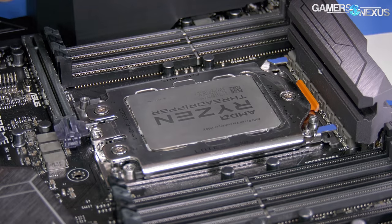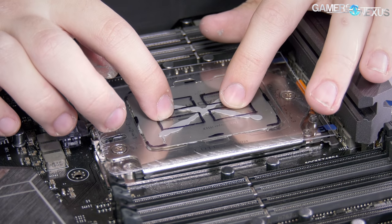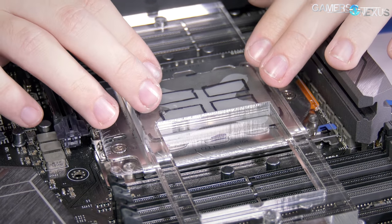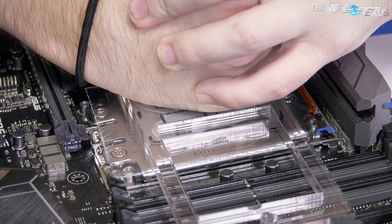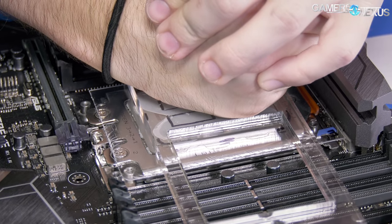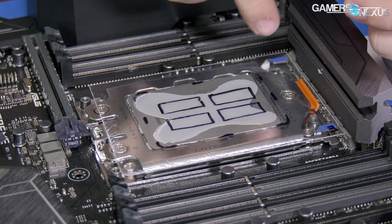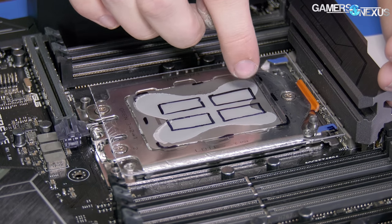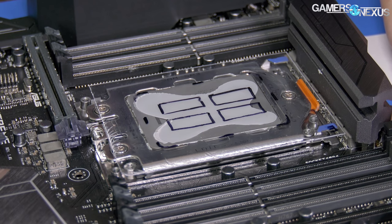Two more methods. Let's do an X. It makes it easier for the camera to see what's going on when I push more force onto it. It's not great — it could work if you used more compound. As you can see over here we don't have full coverage, but pretty good everywhere else. The lesson is just make sure you're at the right height as a starting point. You could bypass that by doing a dot in the middle of the R and a dot in the middle of the N to make sure you cover everything.